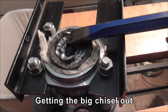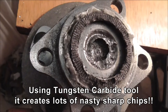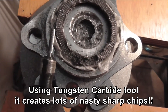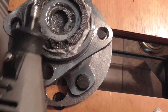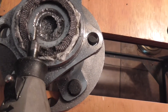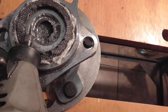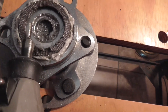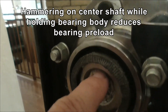Chasing it around with the bigger cold chisel now, same smaller hammer though — I haven't got Mr. Sledge out yet. What I did was buy a tungsten carbide cutting tool for my Dremel, and I'm slowly grinding away at this area underneath what is either the back of the bearing or it's a hardened washer. I'm trying to undercut that using this Dremel.